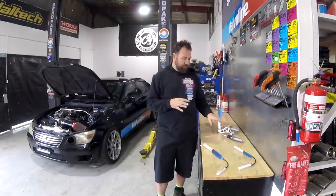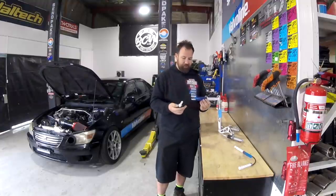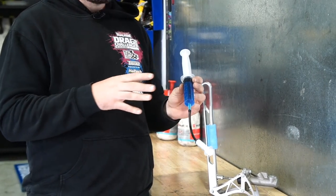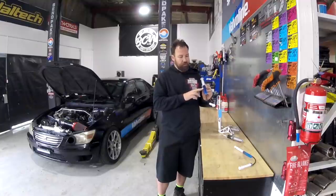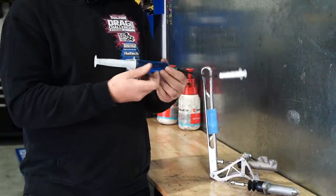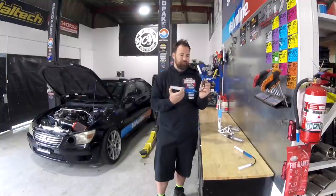But on the topic of that, I've made these little demo rigs. These are literally plastic syringes, and I've built something here which is an over-exaggerated version of what we're doing, but this is a 50 milliliter syringe, and this is a 10 milliliter syringe. So you can see very little movement in this larger syringe completely extends the smaller syringe here.